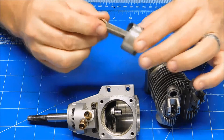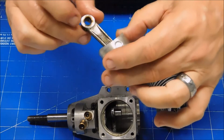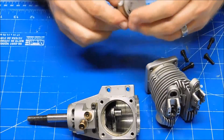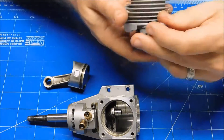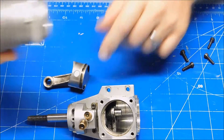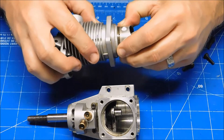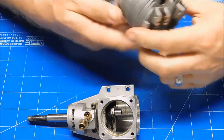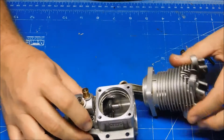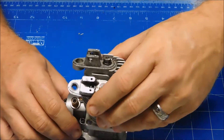Now this connecting rod may be kind of hard to see. It has an F embossed in it, and of course that's also where the bevel bronze bushing is. So that's going to go in like this. I'm going to put a little oil in here, move that up some. This has already got some oil on it. I'm going to go ahead and compress this ring and just insert it in my head. So my head faces this way — my F is here. Put a little bit of oil on this crank pin.